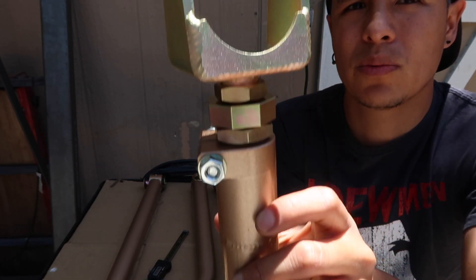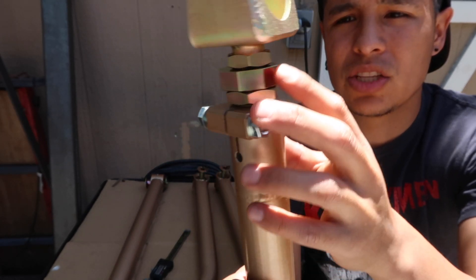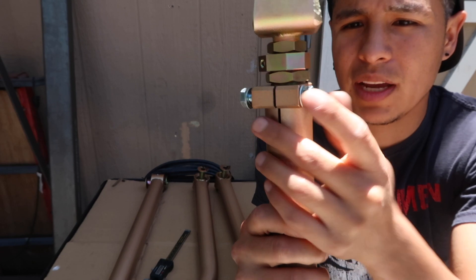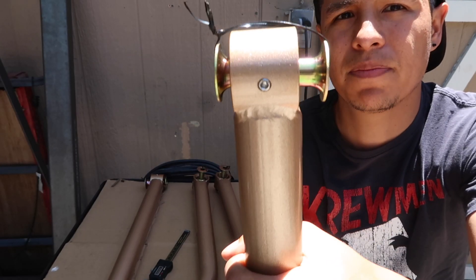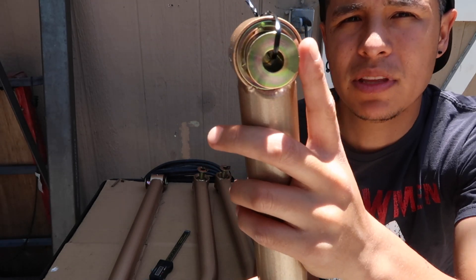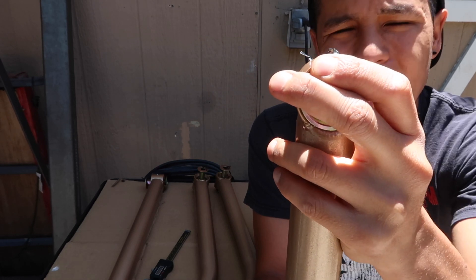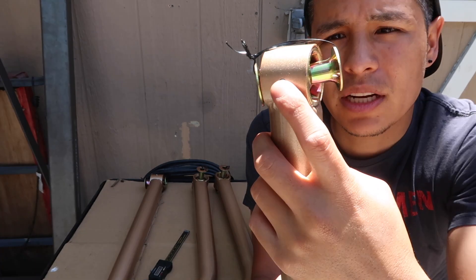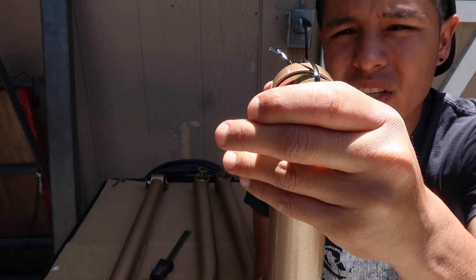Here's where you actually adjust the length of the arm. It has a double lock nut — one with an Allen and then also a nut and bolt on these. For the other side it has a replaceable PTFE lining, kind of like a heim joint style. There's a setting screw so it doesn't come out, and also an actual set screw where you can replace these parts.